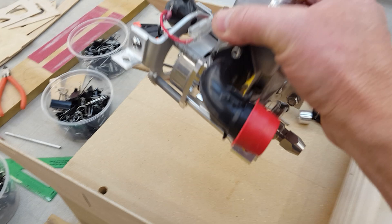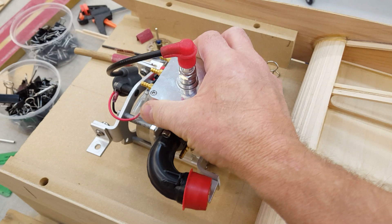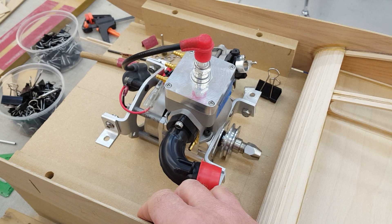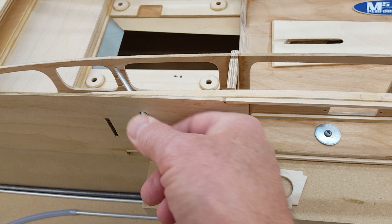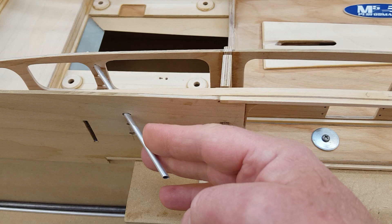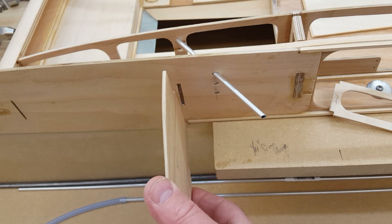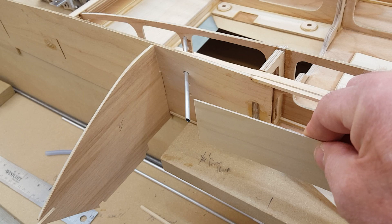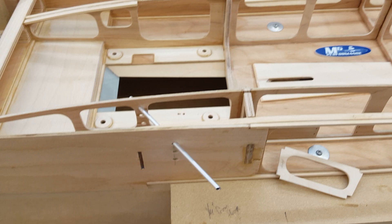The motor we're using has two inlet water lines — see those two fittings right there — and three exits. Quickdraw, who manufactures this motor, says don't run these exits together; run all three of them separately out the hole. We're coming out the side. We're going to install some aluminum tubing that runs through like that. Our non-trip is out here, our sponson transom goes about here, and these three will exit right there and run to the engine. Nice and easy.